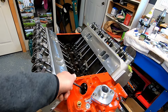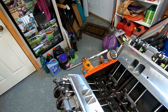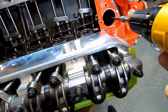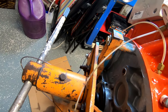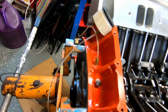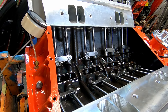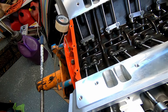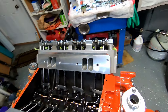So I've got my drill set up here. I've got my priming rods — custom made from many years ago. I primed it just for a second the other day and I think it shot up to 50 pounds or something. I tried to make myself some little dams here to catch some oil — there'll probably be a gusher and I'll have to clean up a mess, but that's fine. I've got an old school rod that I think my dad made, and I try to keep it off the bushing in the center because it might try to chew into that. We got pressure right there — it looks great.